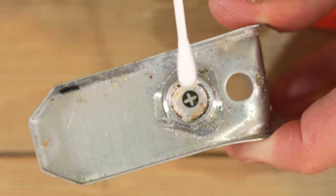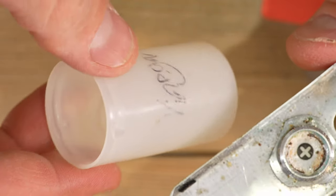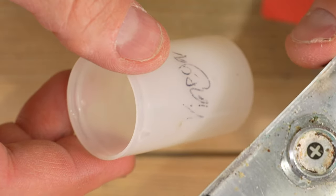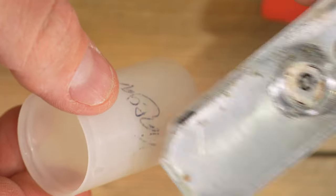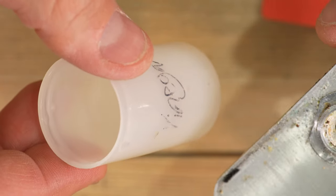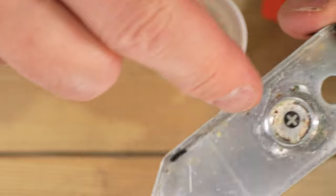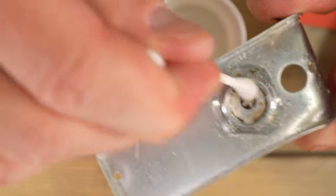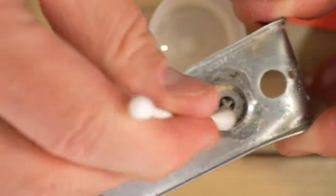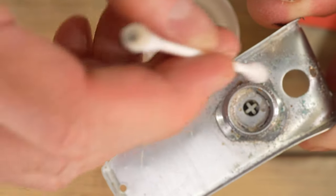If you have a battery cap that has corrosion on it and you've removed it, what I do is take a repurposed film cassette container, fill it with about a quarter to half an inch — roughly a centimeter — of distilled white vinegar, and literally drop the battery cap into it. That allows the vinegar to do its thing and clean the alkaline compound off the cap.